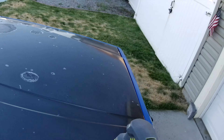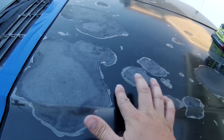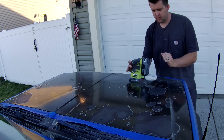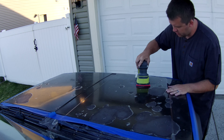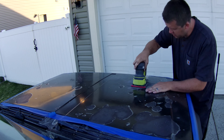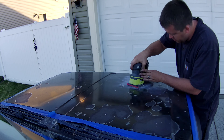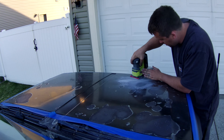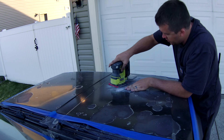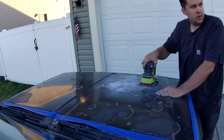Another reason I'm going to be sanding this — you may not have to sand it if you have a good quality paint job. Of course, this one is crappy. I have a scrap piece of tape here, and you can see if I put it down on this spot where we've got peeling clear coat and peel it up — applying, pulling back, getting it positioned just right — all that clear coat came up with it, and now it's ruined. It won't stick in that spot.